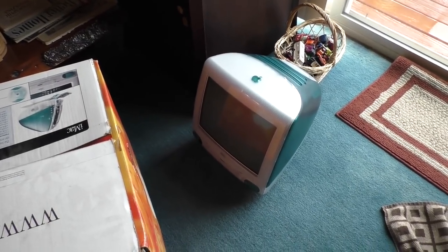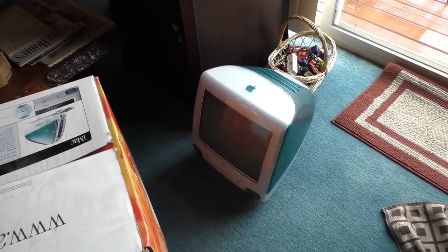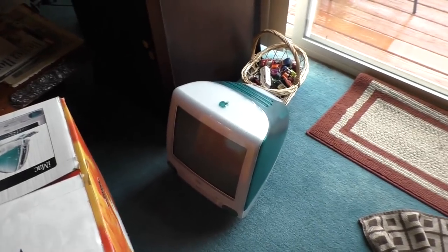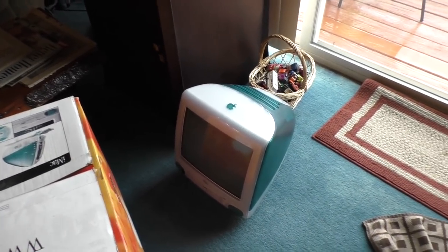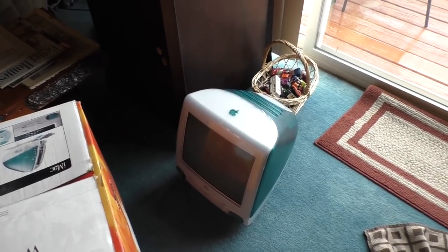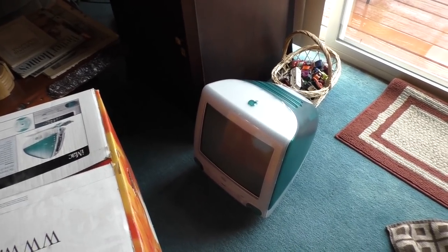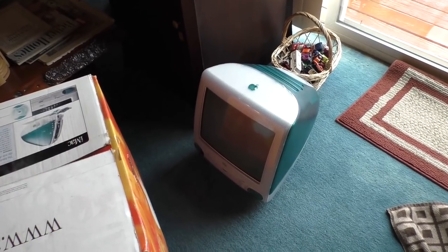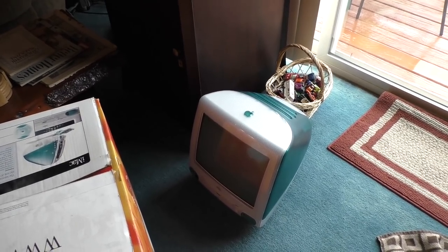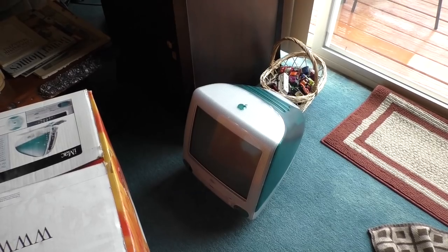I get it. It wants a specific version of Mac OS. So why don't we try Mac OS 8.5. So we're going from Mac OS 8.1 to 8.6, back to 8.5. No big deal. Here's an image. Download it. The first two images didn't work, just as before. Not everything works like you want it to sometimes. So by the time I found the third image of the 8.5 installer, retail copy by the way, I'm not using specific Mac installers, you can't do that unless it's specific to that machine. I downloaded it, I burned it, I booted it, and we're sorry, but this Mac requires a later version of Mac OS.